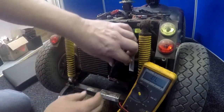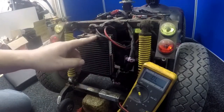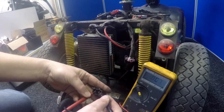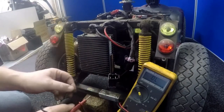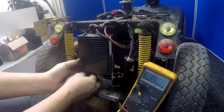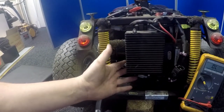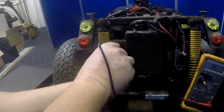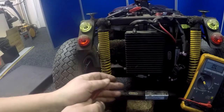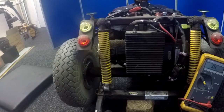I know for a fact there's no brake. I'll remove the connection here for the motor. You want to do that side because that goes into the control box. Put the probes on — one here, one here — it doesn't matter which way you put it round. Continuity — no problem with the motor. Now I'm going to do the same with the electric brake. The electric brake is a little bit shorter, hiding away in here. I'll plug my multimeter in here — continuity on one, one there. And there's no continuity there at all. There's nothing happening — it's a problem here. No continuity, it won't work. There's a problem with that brake.